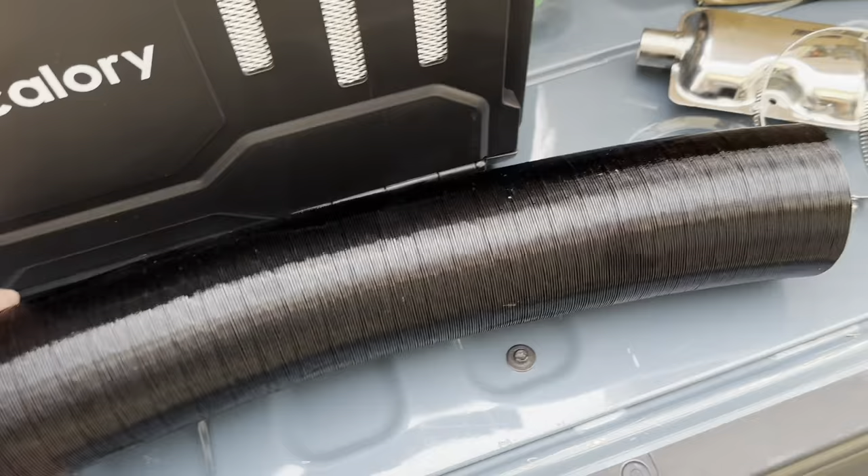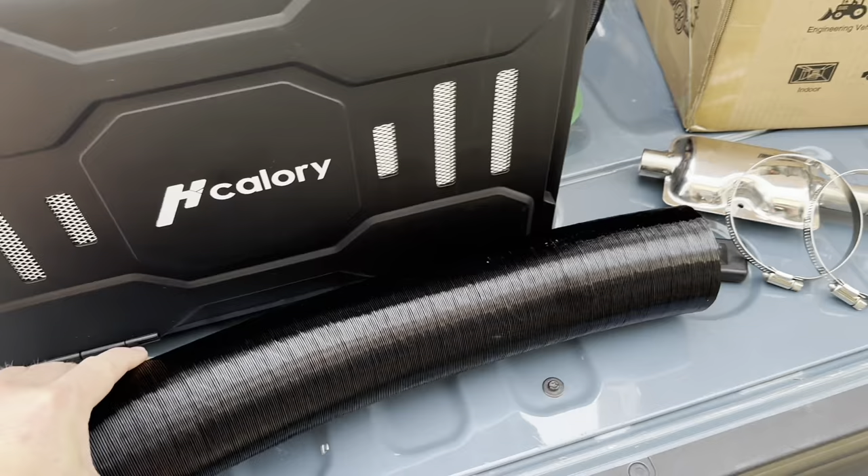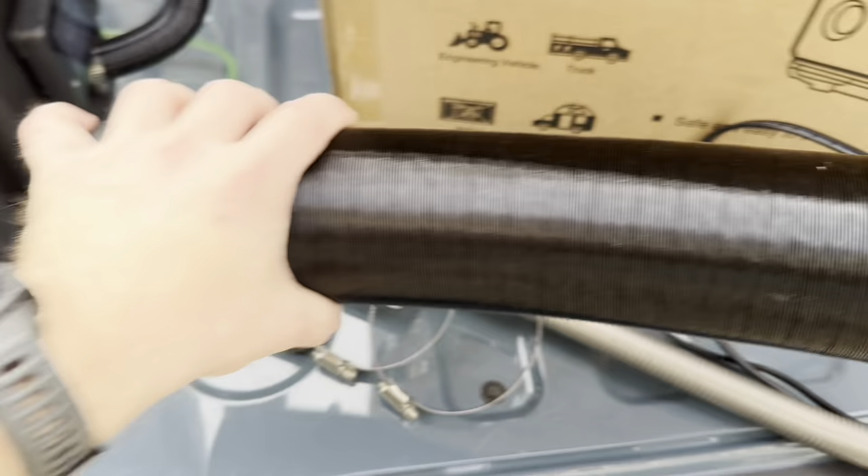There are some leftover pieces. This is the hose that it wants to shoot the heat out of, whether you're using a tent or whatever – it's pretty much useless, it does not expand or anything. I would go to Home Depot, buy an insulated hose, and you can pretty much just channel that air wherever you want. But let's go ahead and push this off to the side.